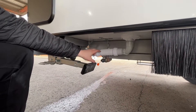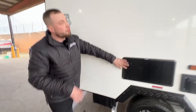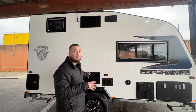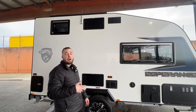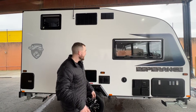We have our mains pressure water filler as well as grey water output, as well as a one-way valve for the shower so nothing's going to come through. Still premium PVC fittings and fixtures. We have two fridge vents here — on the standard Esperance running just the 110-litre compressor fridge you'd have one of these points, but here we have top access and bottom access to get to all the wiring, hookup, motors, compressors and all that. You'll also have a little black vent there for the microwave output.